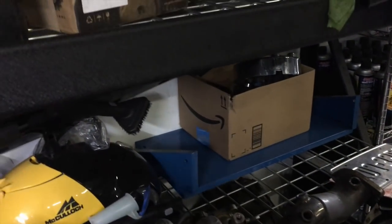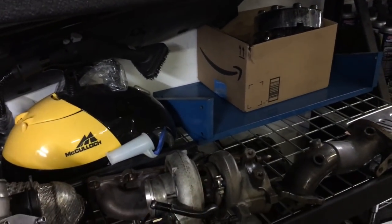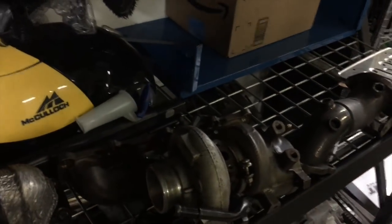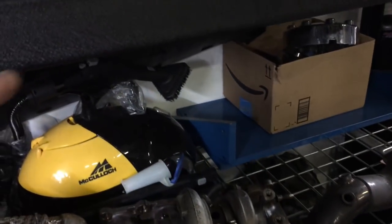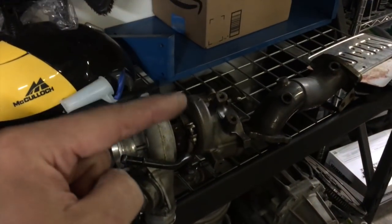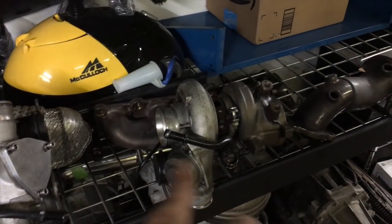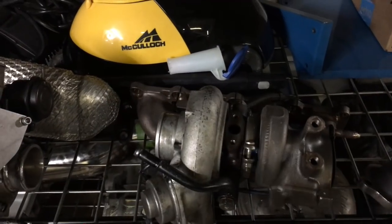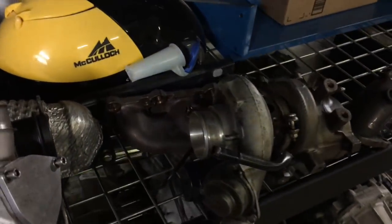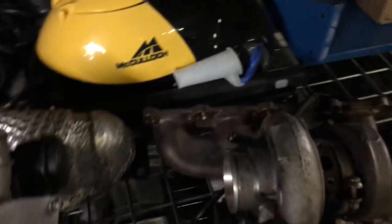The torque graph dies down at the top and so does horsepower — it doesn't shoot up. You can technically convert this to an external wastegate to hold boost more consistently, so horsepower shoots up more at the top. Either way it's going to be very spiky with the internal wastegate because the spring is constantly fighting to hold a certain boost level. That's how the internal wastegate works with the actuator type.